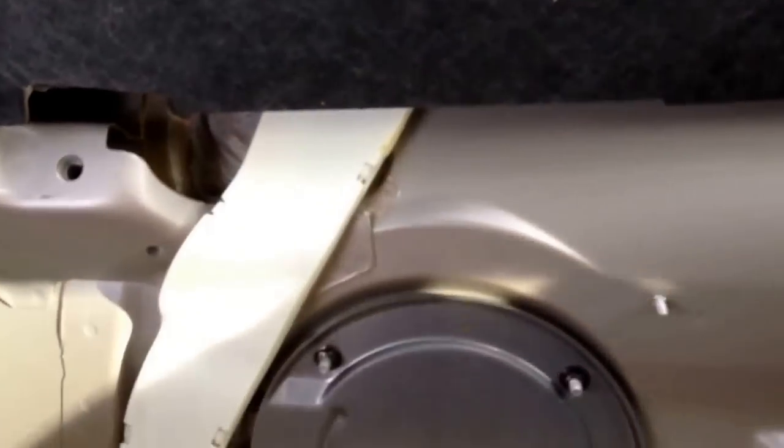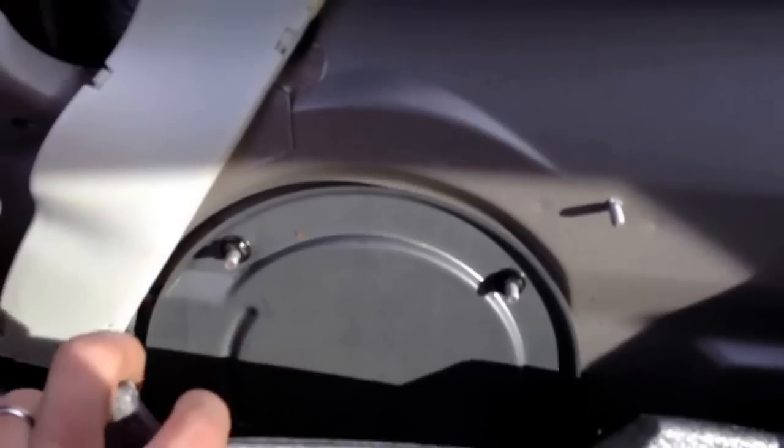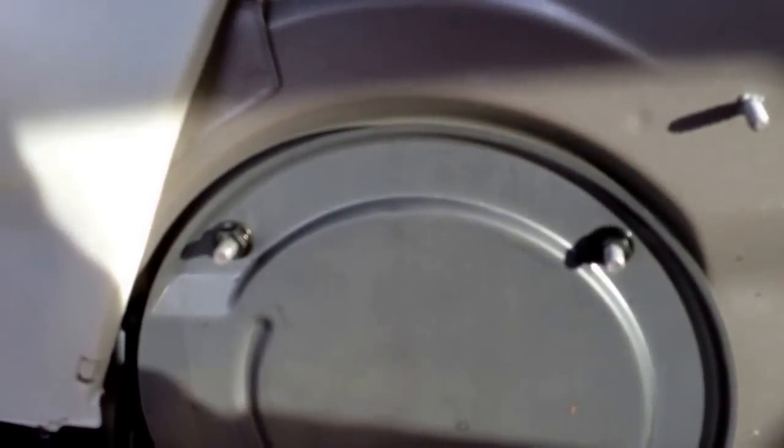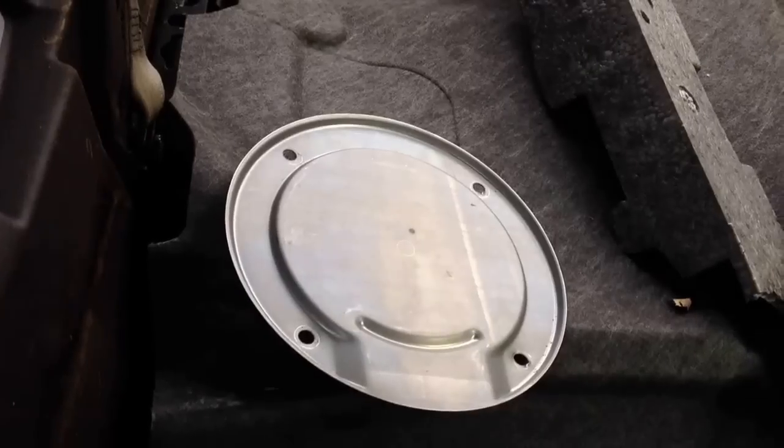You can now roll back this piece of carpet, which will expose the access to the fuel pump underneath. I'm going to remove this little styrofoam insert to get access to the fuel pump right in here, and then I'll access the fuel pump to determine what's causing the fuel leakage I smelled outside of the car.